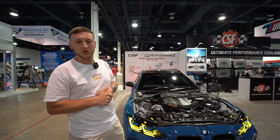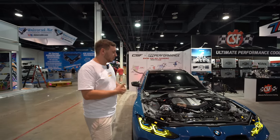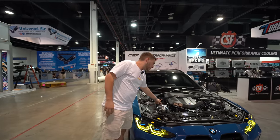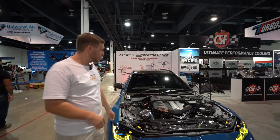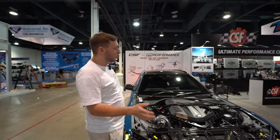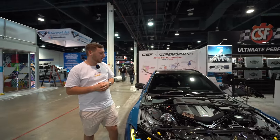This car is a daily driver, it's a tourer. We've used this 8,000 miles across the US over the last 6 months, and we'll continue to do that around Europe, but we'll touch on that later. So 6870 turbo, we've got Turbosmart wastegate, we've got a full catless downpipe system and an R44 titanium exhaust all the way through, keeping weight down at 16 kg.